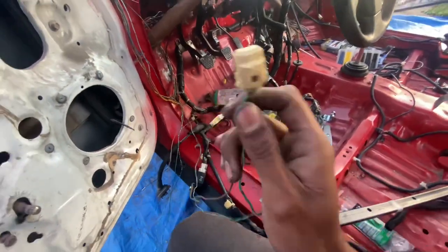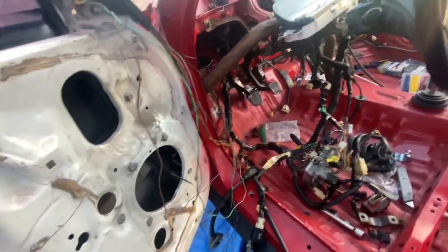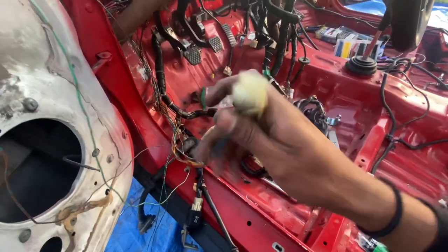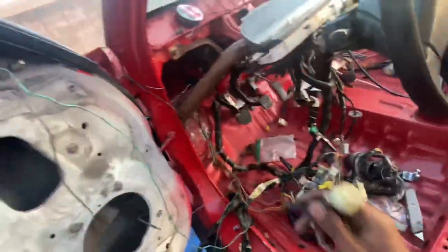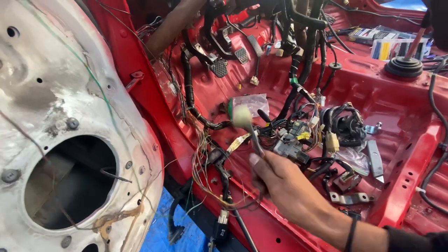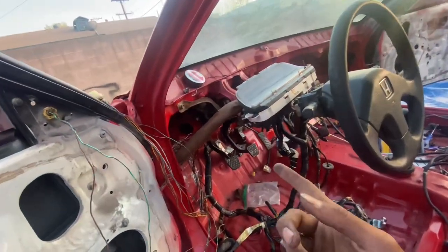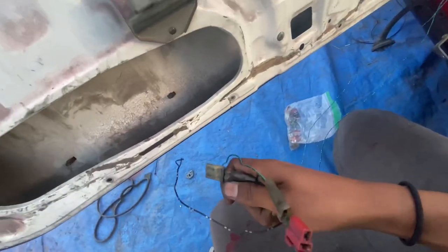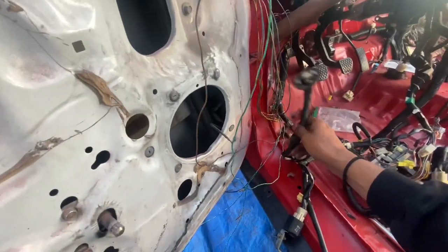We have a few tasks on hand. This is the service port on 88-89s - it's located under the fender - so we're going to relocate that to the under-dash location on the 90-91s. This is our driver's side engine harness connector, which needs to be on the passenger side with the rest of the harness connectors - that's actually what's stopping us from firing up. These two wires are our master cylinder fluid level sensor, just positive and ground. These wires are our washer fluid connectors which we're deleting since we're not running washer fluid. This is our door connector that runs to our speakers.